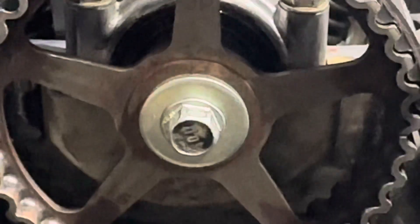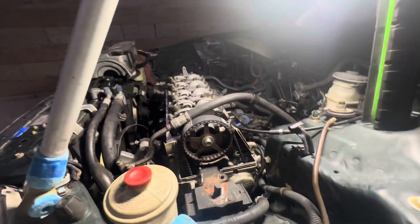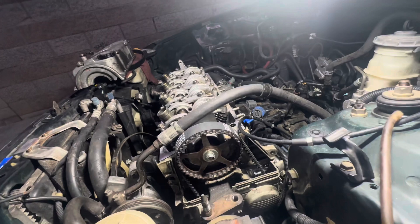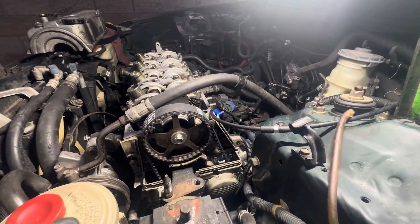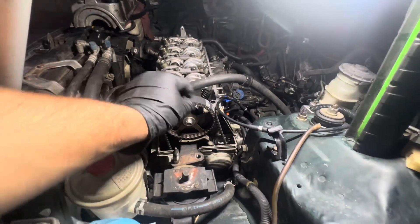We are on the timing mark there, and as you can tell we are on the up. There are the timing marks parallel to each other on the deck — timing mark right there and timing mark right there. By the looks of it, the timing is done. I'm going to go ahead and make sure the tension bolt is nice and tight, put the middle bolt for the cover, and then I might get started on the intake manifolds, but I kind of want to clean it first. The donor car had it painted blue on there. I'll probably wait on that. For now, this will be the timing belt and water pump video on a 1.6 — real easy.